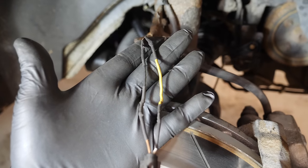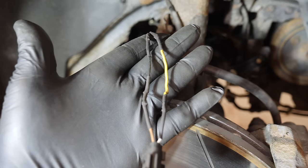In addition to the boost fault, we also had an ABS and traction control fault — you could feel the ABS. Then I couldn't get into fifth or sixth; it was like it was going past the gate into reverse, so fifth and sixth were really difficult to get. When I Googled this problem, it was the most random, bizarre chain of things all related to one issue I've ever heard of. This is what's causing it — you can see that's already had a repair once, the cables in the centre are a completely different colour, but it's worn through again, so I'm replacing the whole thing.